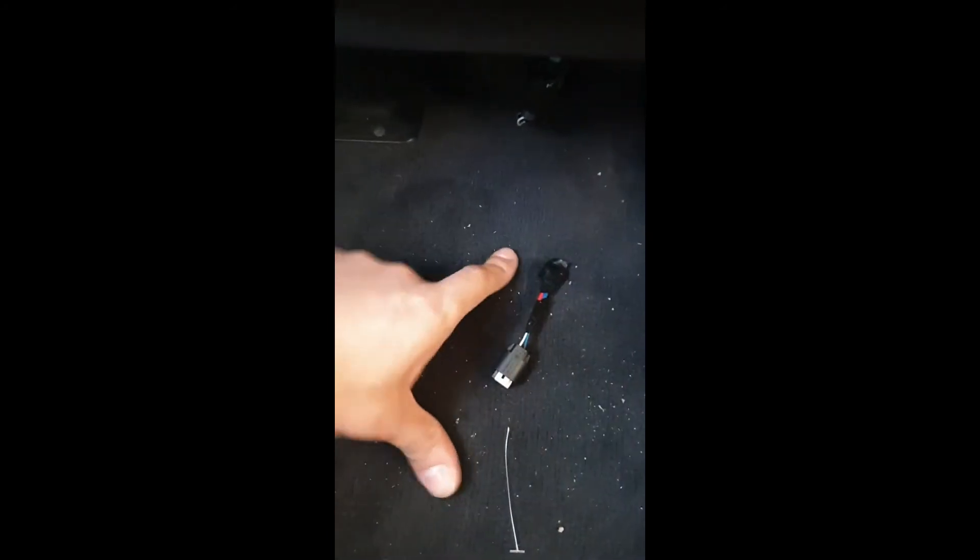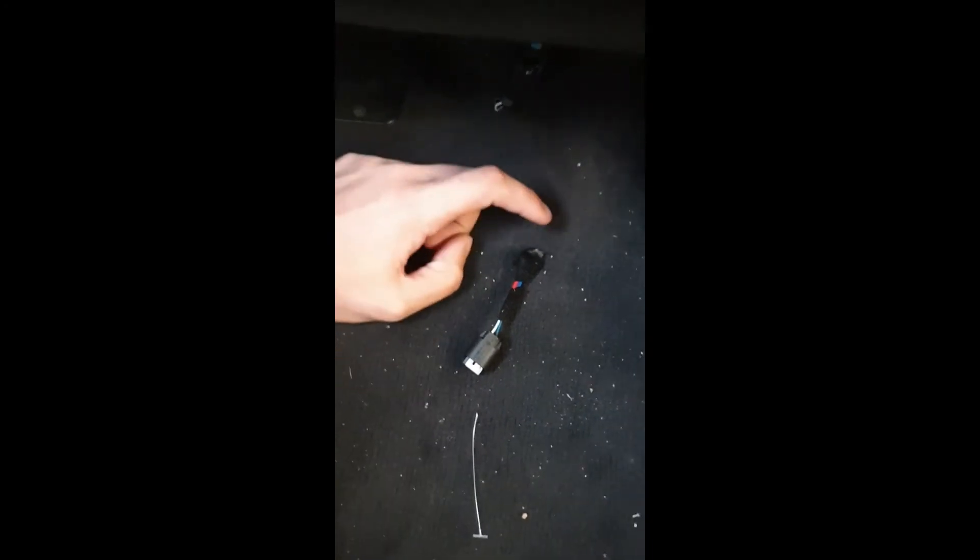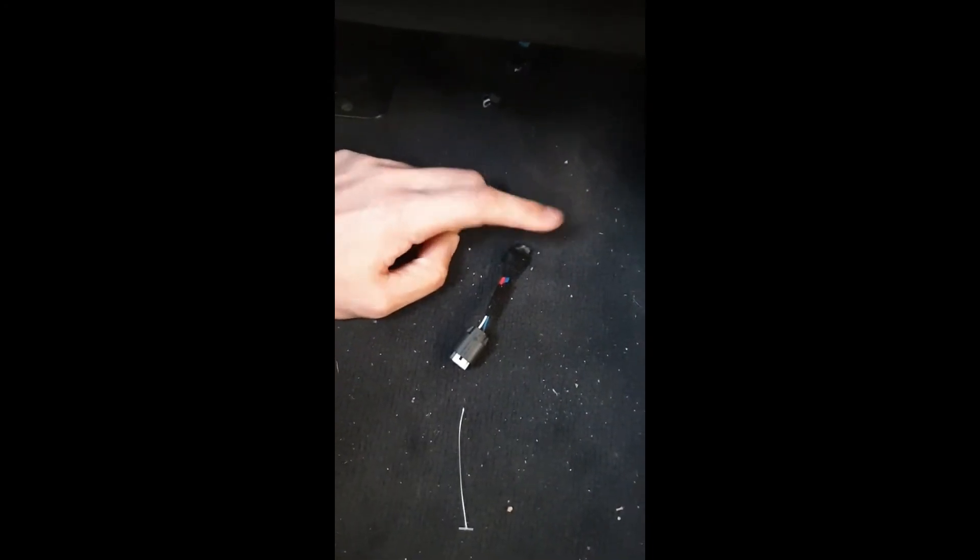With the help of YouTube and the code that's active on my car, what I've done is taken the plug of the mat sensor and cut it off — there's no point keeping it on there because the sensor is broken. I've put a 1K ohm resistor, a 1N4001 diode — it's a 50-volt one-amp diode, a really small diode — and another 100-ohm resistor. I made sure the silver side of the diode is facing the blue wire, so blue wire to blue wire.